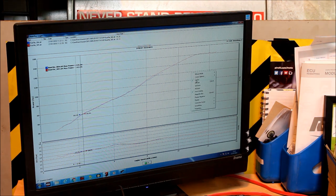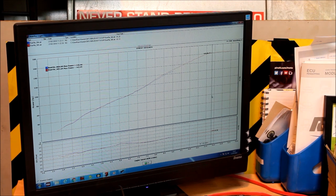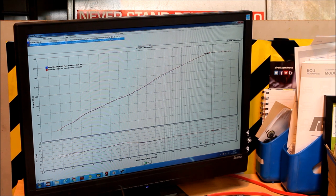And then you can see here, it's so lean. I'm not even going to do another base run because it's going to cook itself. That's no good for it at all. So that's what we're going to take as our maximum. I'm not prepared to keep running it like that because you're just going to drum a load of heat into the plug. It's a hot day as well. So we're going to take that as our base figure. I'll save that as our maximum original.